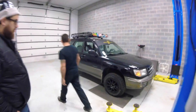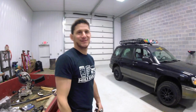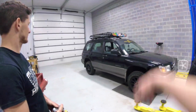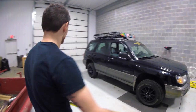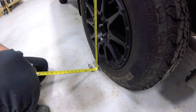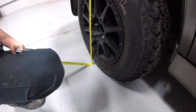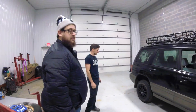Now we can measure this up — look how high that is! So we had 29 and a half in the rear and 30 in the front. We attributed that difference to saggy butt syndrome. We're going to measure this up now with the two-inch front and two-and-a-half-inch rear lift kit. Thirty-two and a half — that's a two and a half inch gain. And the front is about 32 and a half also. Perfectly level lift. So it really was saggy butt syndrome and that's all fixed up now. How do you feel about the height? Much better!